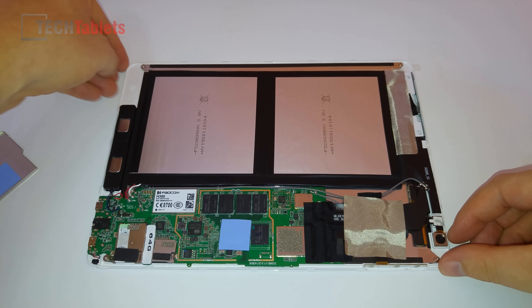I'm just doing this mod for someone who contacted me via my website and asked to have the latest 64GB model and if I could do the mod for them. They're just paying me a little bit extra on what I'm selling via eBay. I already tested this model — it got up to 51, 53 degrees doing a stress test from CPU-Z, so the temperatures aren't bad at all.